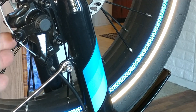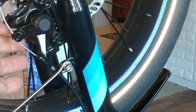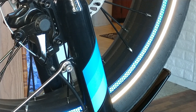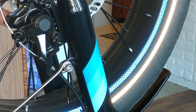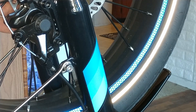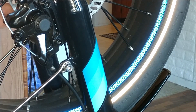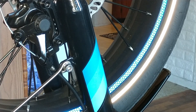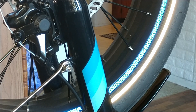To summarize the three parts: first, centering the brake unit on the rotor; second, the inside pad adjustment — on the inside facing the spokes; and third, the adjustment with the actual cable itself. It's easy to do — just make sure you take your time and don't get in a rush.